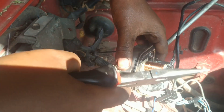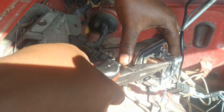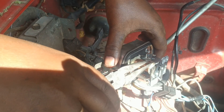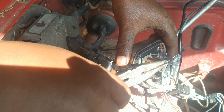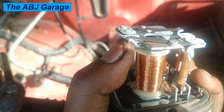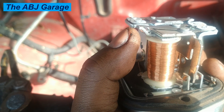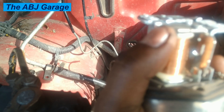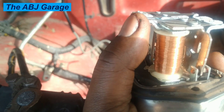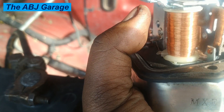If you want to check how the voltage regulator operates, there is a video in the description covering how to identify the different terminals. This video is only concerned with the adjustment. The voltage regulator is adjusted by bending the spring seat — bend it up to increase the voltage and down to decrease it. Use a long nose plier, insert it between the spring and the spring seat, and bend it up. This pushes the armature away from the coil, increasing the voltage required to pull it down.